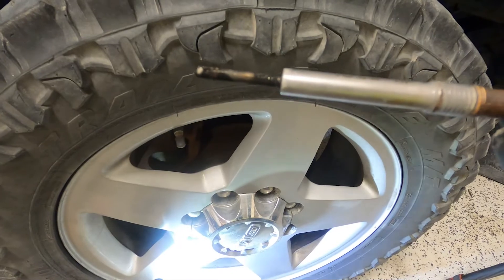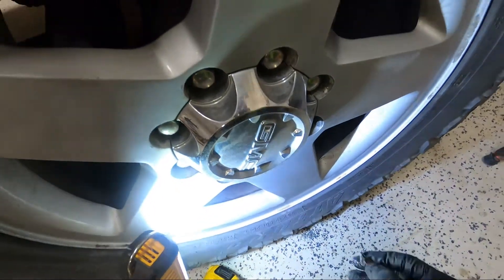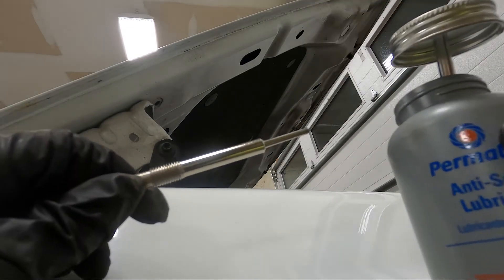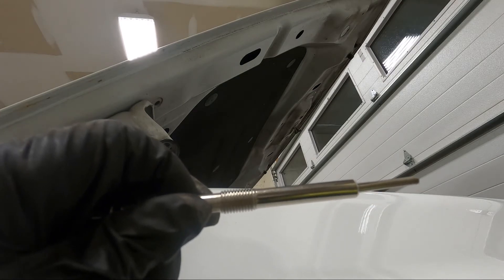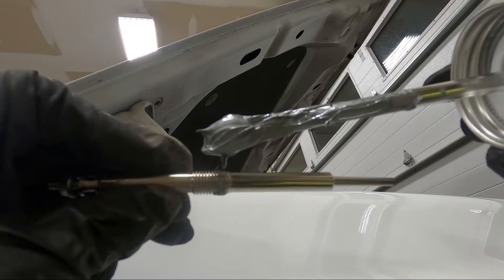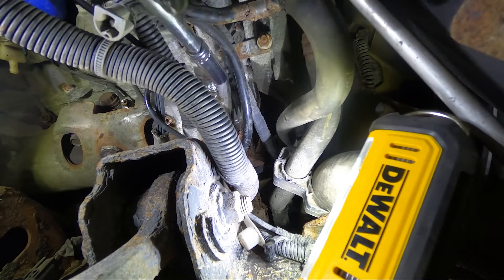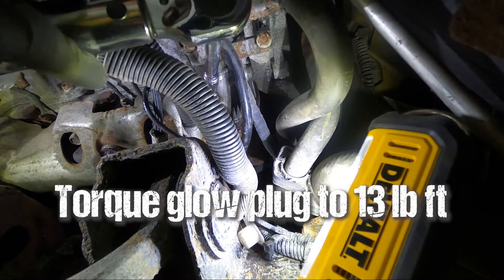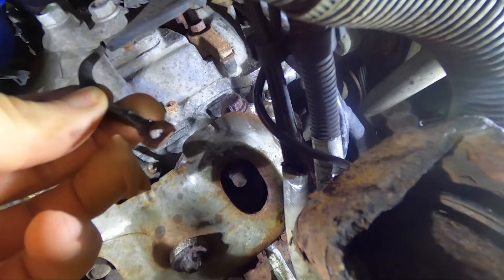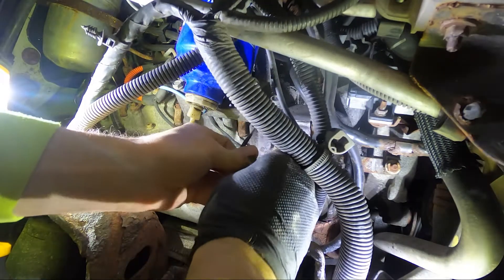Maybe it's black — she's not burning properly. You can see the end of it got sheared right off. There's the other piece. We're not going to get too wild with this, but here's the Permatex anti-seize. Here's our new glow plug — just going to put a little bit on the threads. Tighten it by hand. I noticed the little eyelet for the wire is very rusty, so I'm going to clean that off with a little piece of emery. Much better.